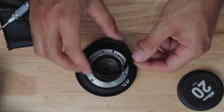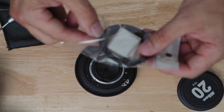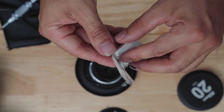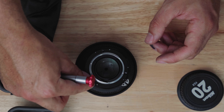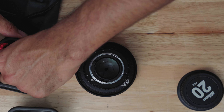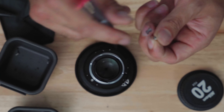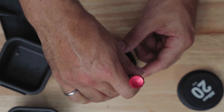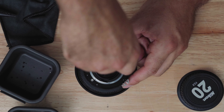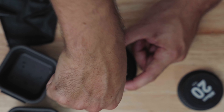Next is converting this to EF. I take the first part of the kit — the spacer — and place it over the lens. Then I open the secondary packet, which has the EF converter ring and a bunch of hardware. I line up the holes and put the screws in. These are extra-long versions of the original screws. The screwdriver included has a magnetic tip, but these are stainless steel screws so they won't stick. I'll get all three in finger-tight before fully tightening.